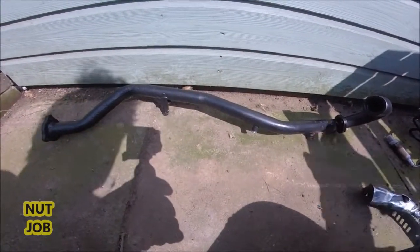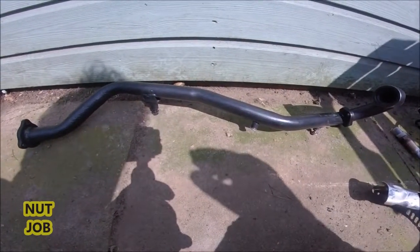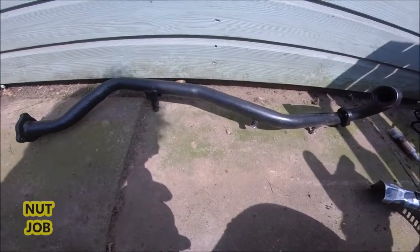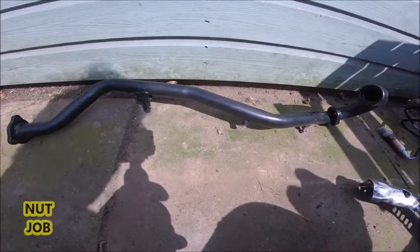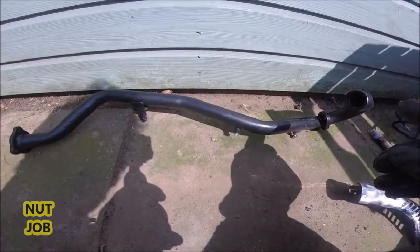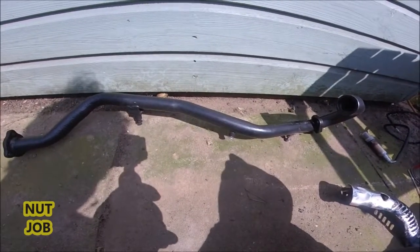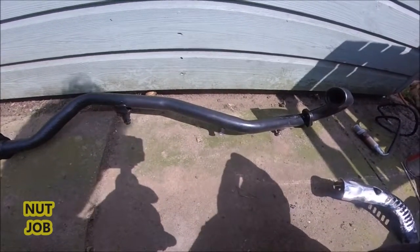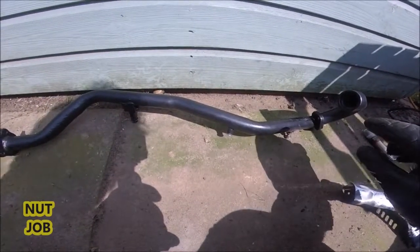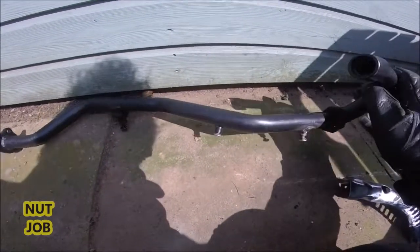But with the motorbike and other older cars, you don't have electronic fuel injection, you have a carburetor. So to get around this, what they used to do was they'd drill a hole in the exhaust pipe near enough to the engine, and they would either spot weld it afterwards, or put a self-tapping screw in it, or if you're a rat bike enthusiast, you'd put a Jubilee clip with a bit of tin can over it. But the method I've chosen to do